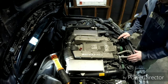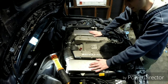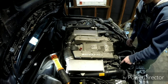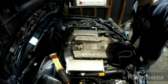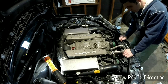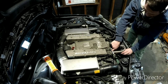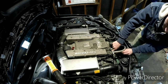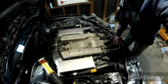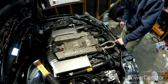You don't actually have to take the supercharger off all the way — I'm going to show you that. But you do have to unhook pretty much everything. You have to lift the back side up a little bit without fully removing it, so you don't have to take off the water cooling lines, which are a real pain. You can leave those connected. The first thing is to unhook the magnetic connector on the supercharger pulley — there's a little connector, pop that off so it's out of the way. Then undo these hoses, which I've modified this one because the original broke.